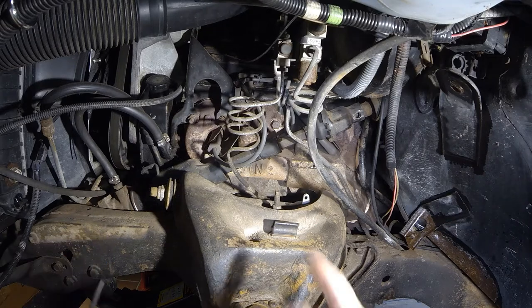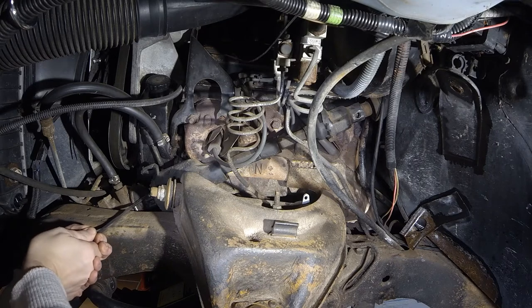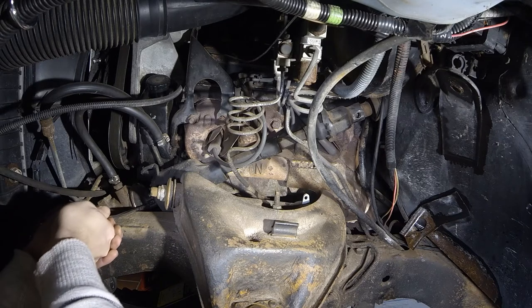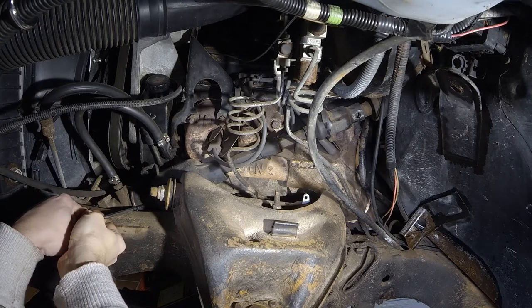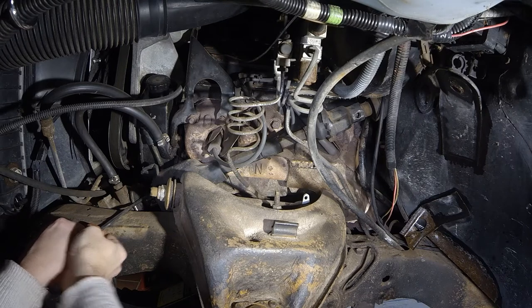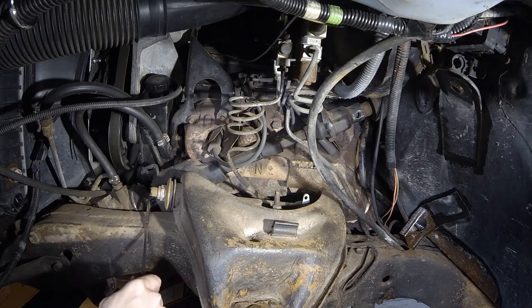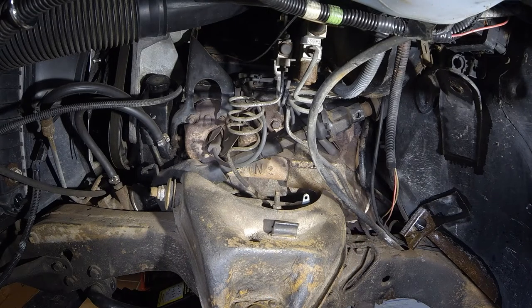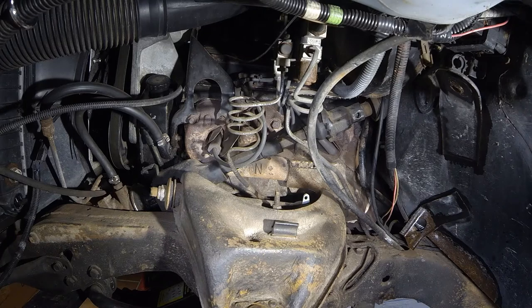It's been sitting for a while now. Applying some pressure — and there's movement, you can see it! It does slide in, so that's very, very good. Before this one slips off, I'm going to center the wheel, center the hub down here, then click it one spline over, put it back on, and see how the alignment is.